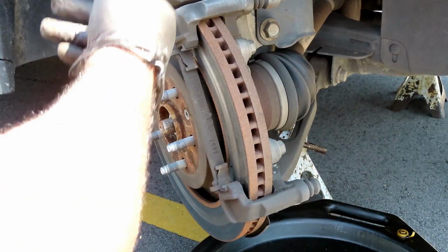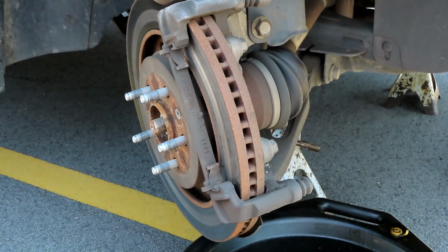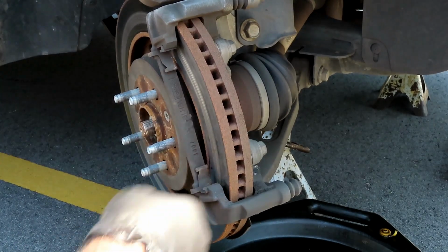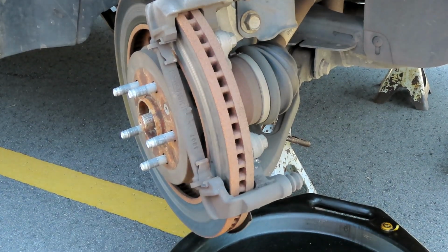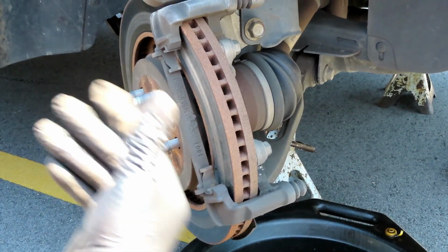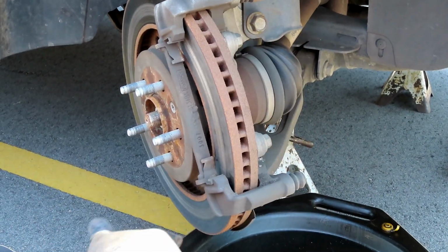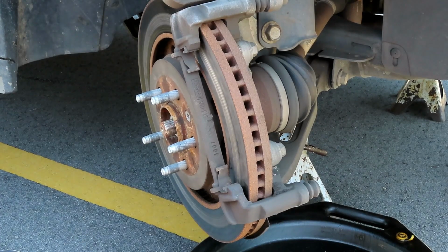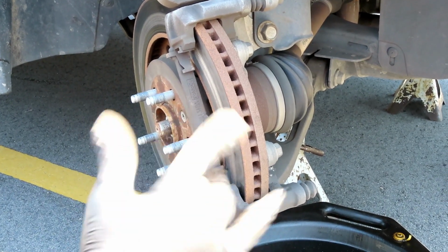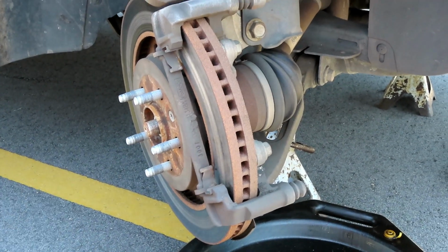See, I hate when people, and this is supposed to be a teacher talking. When you use that cheap silicone up there, dirt and weather will just wear that away, which happens right here. Anti-seize is waterproof, so it's going to stay there and keep that lubricated. So, to that teacher out there, you've got to go back to school and learn your stuff. Yeah, buddy. That's why you're watching us.